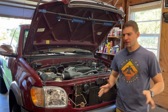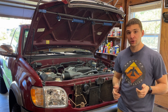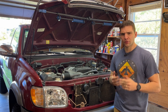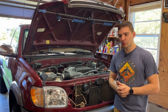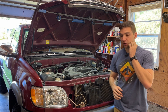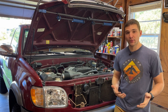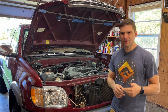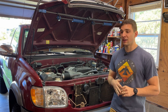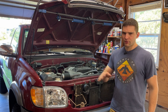First start went well. No glaring issues. The belt's not frayed, there's no weird noises or anything going on, so that's good. I won't know for sure until the morning if it solved my squeaking issue, because that's typically the only time it happens. But for now everything seems to be working well. I'll have this belt linked down below — I went with the Gates belt. I got mine at O'Reilly's for about 36 bucks, but Amazon has the exact same belt for less than 25, so I'd recommend just going that route.